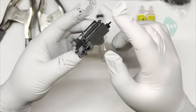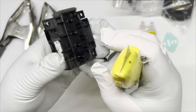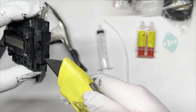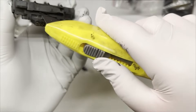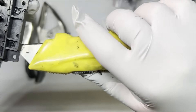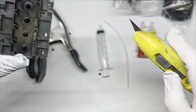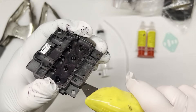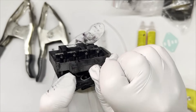FFC cable points to the sky. We're going to work on the left and the right side. On the side you're going to see a seam. Point your razor blade inside it, just a simple twist — you're going to see those seals fall off. Two fall off and there are two more. Twist, nothing falls off. Twist one more time, nothing falls off. After the four seals fall off, you give a harder twist, then you can use your finger to push it up and they're going to separate.